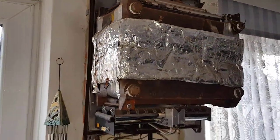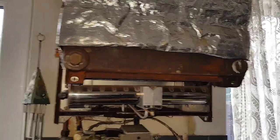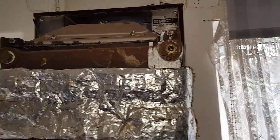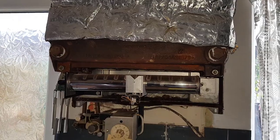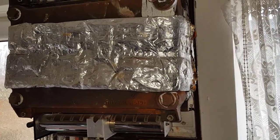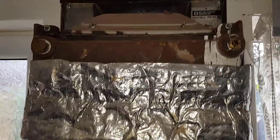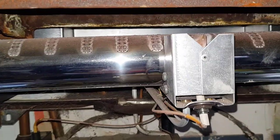This is what's inside this big beast. This massive boiler is only 40,000 BTUs compared to a modern boiler which is half the size — that's how they did it in those days. Big massive cast iron heat exchanger giving all the heat, so there's a lot of heat loss from this boiler — it's quite inefficient.